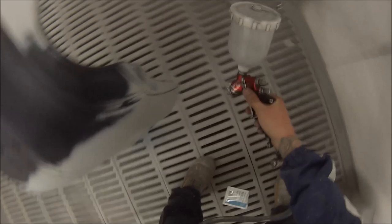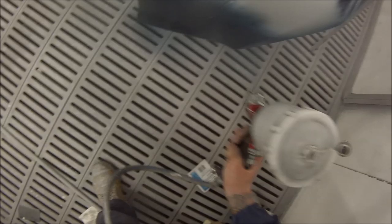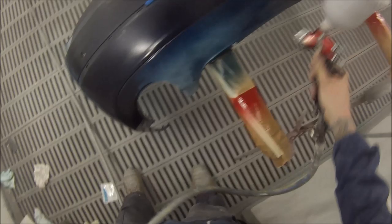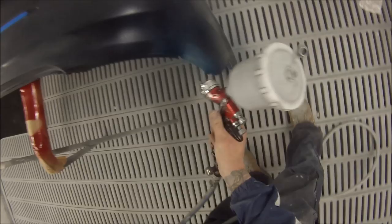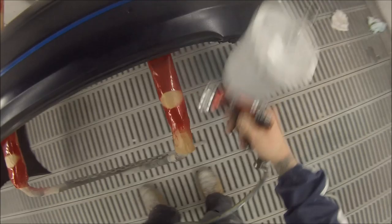You can see this colour covers extremely well. Most of the blues and darker colours in the Standox Solvers range cover quite well. Sometimes it's the silvers, the reds and the greens where you really get coverage issues, and of course the silvers are going to be the worst for coverage. The finest silvers are usually pretty good though. I've got the booth up to about 30 degrees — I like to get it nice and warm as it speeds the job up and enables you to get those face coats on quicker.